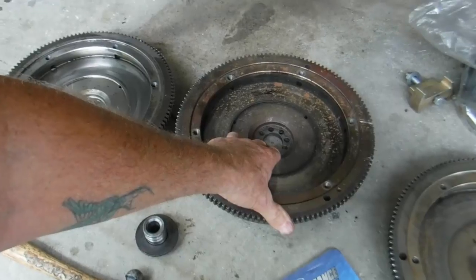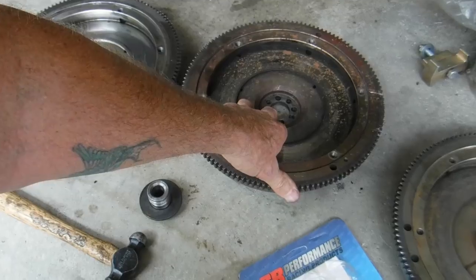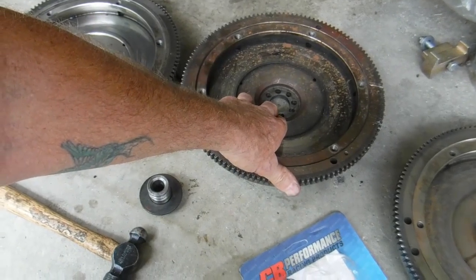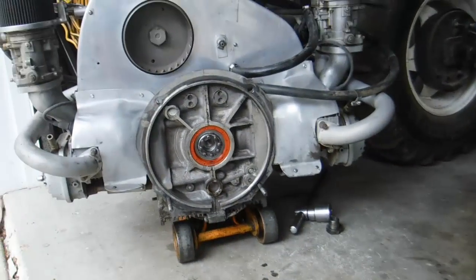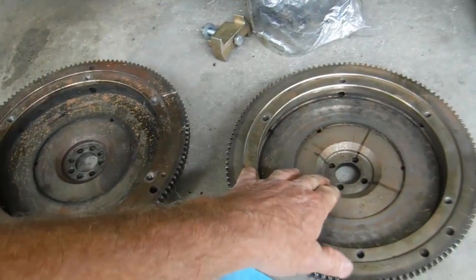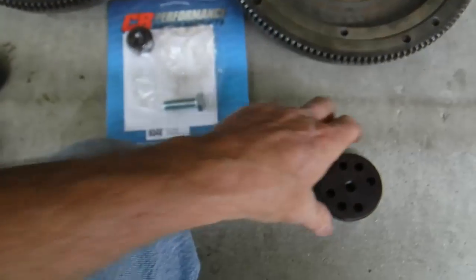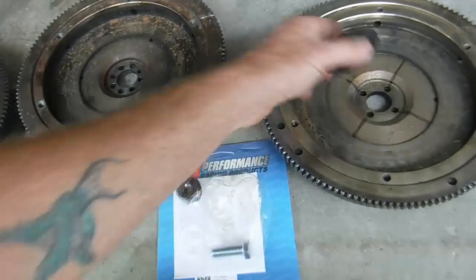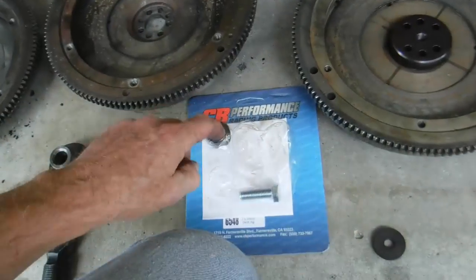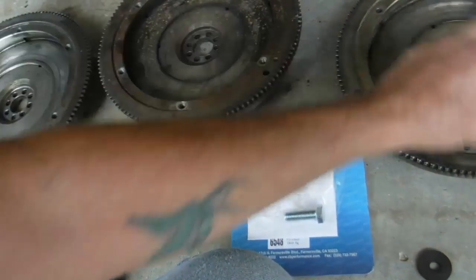I did this without a jig 20-some years ago. Ran it for years and years on that. I really had to jam it on that crankshaft, and I thought maybe I could get by with it on this one, but it just didn't want to go. So rather than force it, I'm going to take a stock flywheel, and at some point in time I ordered this jig for making those extra dowels. We're going to get the directions out, get it over to the drill press, set it up, and check that out.